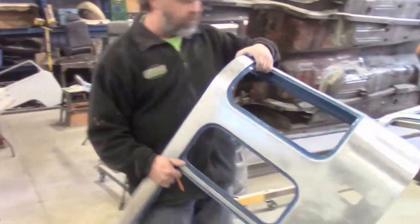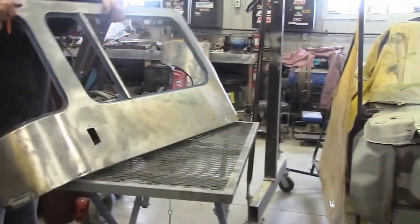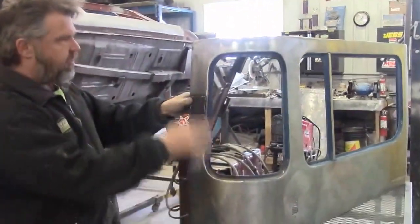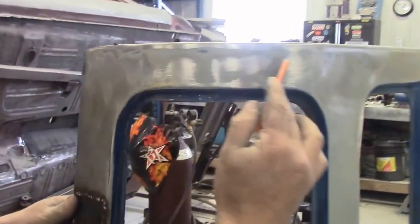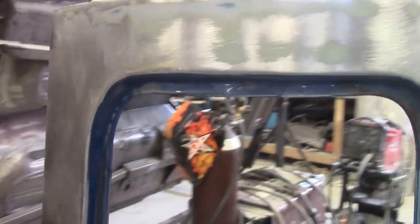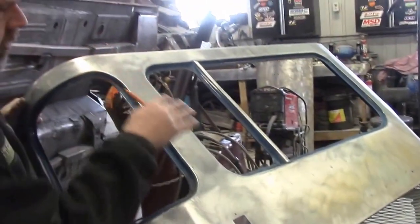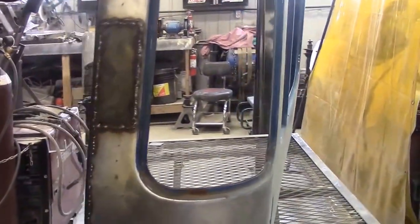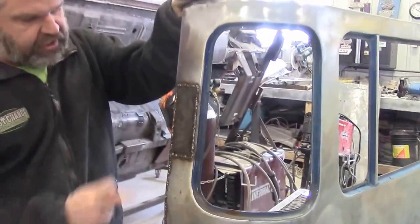This is the driver's side. Over here behind me on the table, we're making quite a bit of progress — this is the rear passenger section. Same kind of idea: we removed all the glass and the rubber and stripped the exterior of the bondo. You can see once again we've got some low spots with body filler from a previous repair, and remnants of more body filler down here. The main step is to expose the sections that require cutting out and new steel being put in. You can see in this back plate — very similar to the driver's side rear section where the hinge plate was.